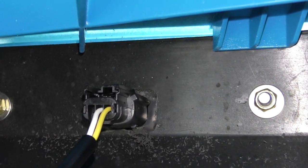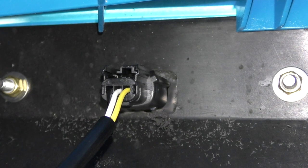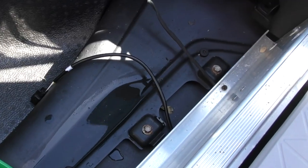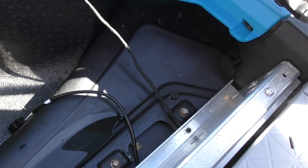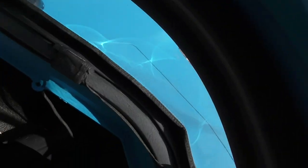You can hear it snap into place when it's fully seated — you can hear it and you can feel it. Just remember these little tabs go up. There's only one way it'll go so you should be good. On my port side I couldn't get that snap on the connector, so I didn't take enough of the material in the center where the connector is off. So I'm going to have to take this off. I put a piece of tape over the front because as I undo the bolts, it may fall completely off and shatter on the pavement. So I'll use tape to keep it in place and then take my screws off and widen my opening.